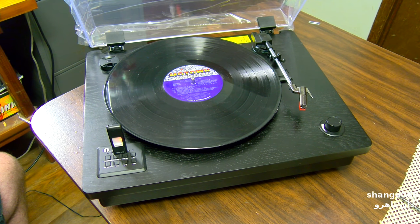The USB stick recording is an extreme disappointment to me. That to me would be the feature of this record player. Hey, I got some old record. I want to use that audio track in a video. Let me just pop it on this thing, plug a stick in there, and we'll cache it to the stick, and then I can dump it in without all this big setup of the commercial gear. But that's an extreme disappointment. I would highly suggest that if they got to go with that poor of a compression, switch it to 44.1 at 96 kilobits.